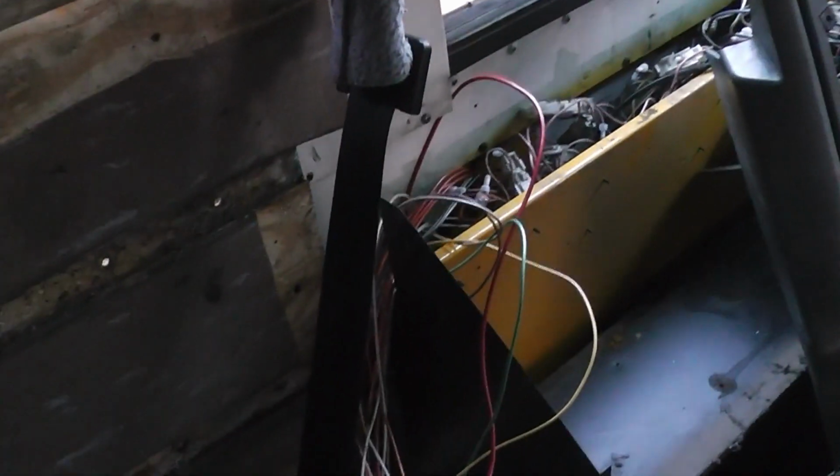Sweet. So, yeah, back over to this harness here. I'm gonna let the engine run for a little bit, charge the battery up. But here, we've got that harness I showed you. But if we follow it towards the back, as you can see here, this jumble of wires, we've got stuff crisscrossing into different harnesses. So I want to simplify this and shorten the overall length of wire so then we can have it come up here, and then we'll have the air door go across that way, and we'll have all the blinkers go back across this way. So yeah, now it's just a matter of shortening up the wires and matching the color on that harness. That's gonna be pretty easy at this point.